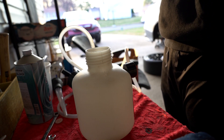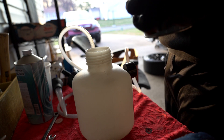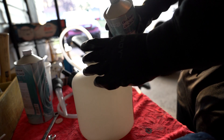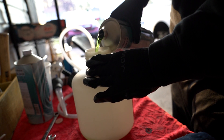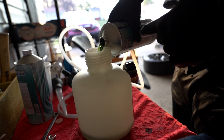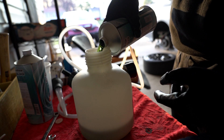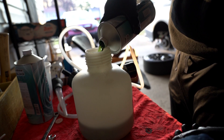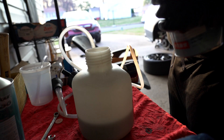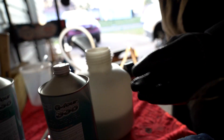Typically you'll need about one liter to do a complete flush. We're going to fill this up with a liter of fluid plus a little extra just to be safe. As you can see, this fluid is green, so it'll be easily visible once we start bleeding the calipers to see when the new fluid's made it through. We'll do one liter for now, then crack open another one and add a little bit extra.